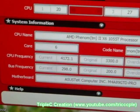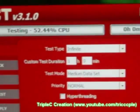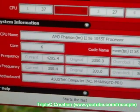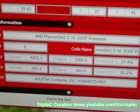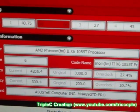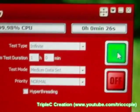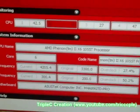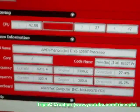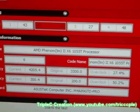This time around I dropped it to 297. Here it says 298, but let's see the difference. You add that 3 on the value when it's on low. I don't think it can do more than 4.2 GHz, but we'll see if this one's stable enough. I call it 4.2 even though I set it to 297 — technically it should run at 4.17-something GHz — but I think it's fair to say this is a 4.2 GHz setup.